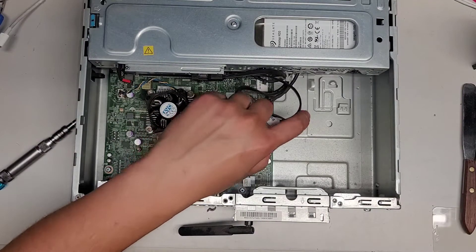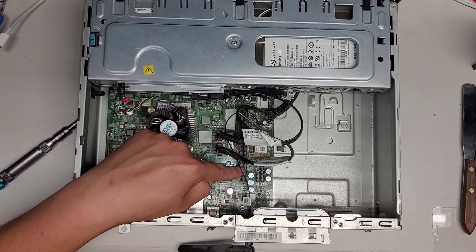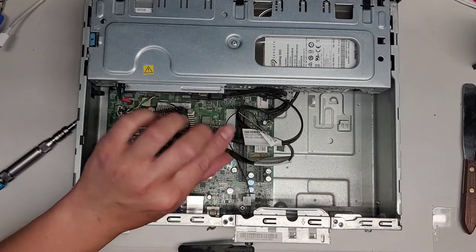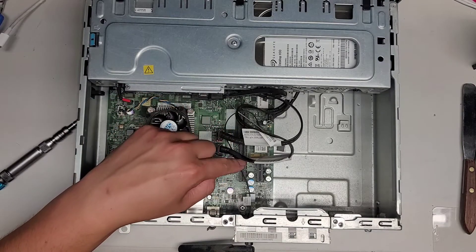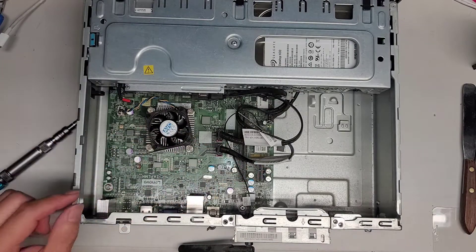The wireless card is just like every other laptop card. It does have a space here where you can put a dedicated graphics card, but because there's so limited space, you're going to have to use a very small, low-powered graphics card. And then there's also a PCIe slot here.